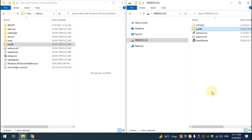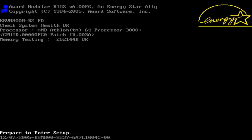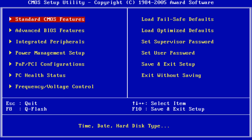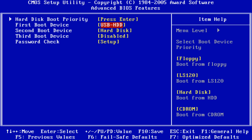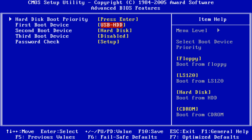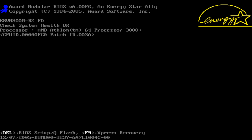That's it, all done. Ejecting the USB flash drive and switching over to the retro gaming PC. On the retro PC, press the delete key to access the BIOS. This machine has a 32GB SSD as the hard drive. In the boot order, make sure it is set to USB hard drive, CD-ROM, floppy, or zip — one of these options should work. Press yes to save the BIOS settings.